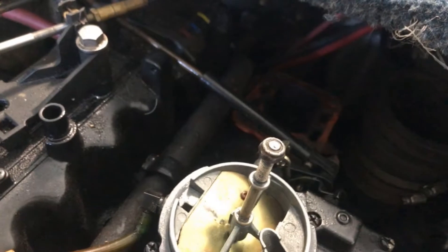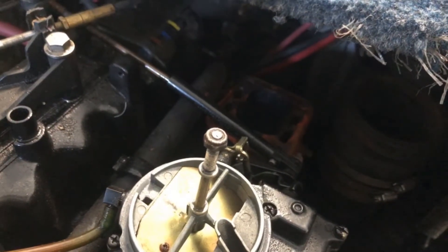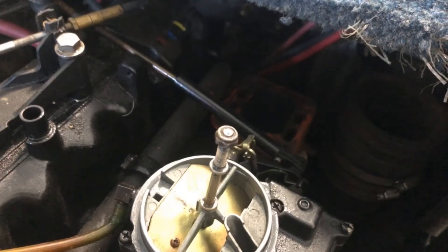I think somebody slapped this gasket on there with some silicone in hopes of fixing it. The manifold itself doesn't look too bad though. So I think that's basically it — I'm going to try an exhaust elbow, do an oil change or two, and run it for a while. Then I'll check that rear cylinder to see if we've got any water coming back in. Thanks for watching, and if I have any updates and it wasn't the issue, I'll add it right to the video.